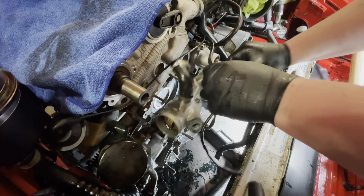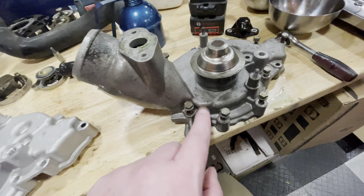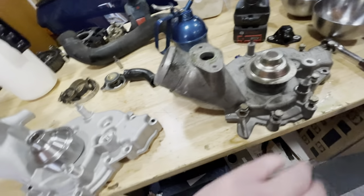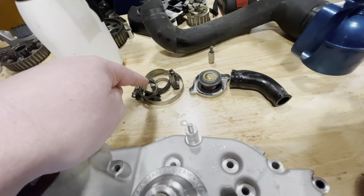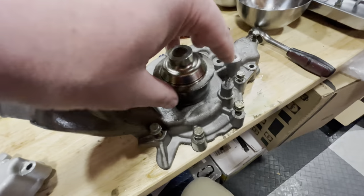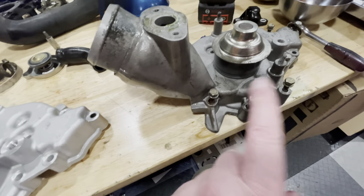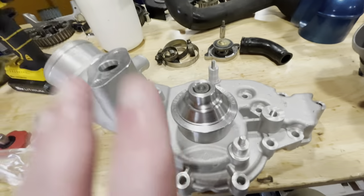She's free - good stuff. So this is the old pump sitting on my bench now with the bolts in the right position. They are not the same length, so make sure when you take them off you put them into the new pump and then swap them over again when you're ready. All of these jubilee clips I need to clean, I need to clean these pipes - there's a bit of cleaning to be done. I have lots of new service parts that go on to this guy. This pump is not in bad condition at all - it's actually in really good condition. I don't know how old it is, and if you don't know how old it is, I think replace it. This is a Gebr pump, it's made in Germany, so this is good quality stuff.